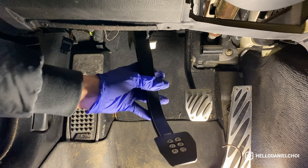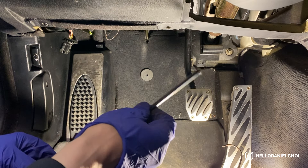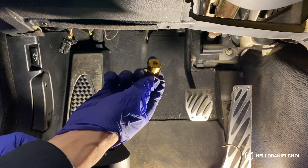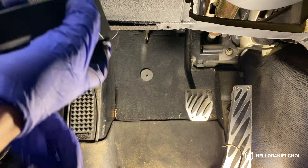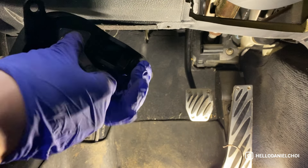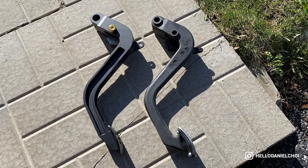I'm going to install the new clutch pedal from Rogue Engineering. You have to use a 6mm hex Allen key for installing the hydraulic system itself. Don't forget your bushings — make sure you put those in. And with that, let's give it a shot. I finally got the clutch pedal out.